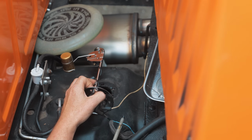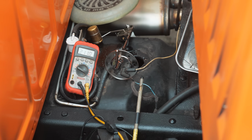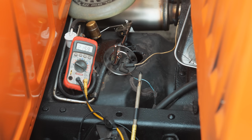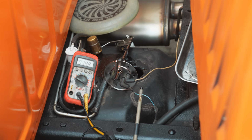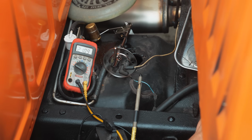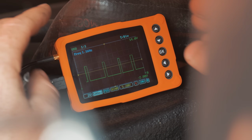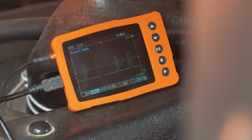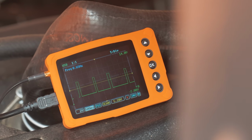But let me show you voltage first. Why is that bouncing around? I need to answer a question for myself here real quick. I knew these were pulsed, but didn't know that they're only pulsed when there's a load. I'll be showing you some scope stuff here in a second. Huh, that's kind of cool. Open signal is a steady 5. With a load, it's pulsed.